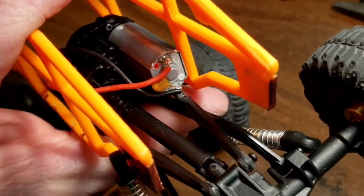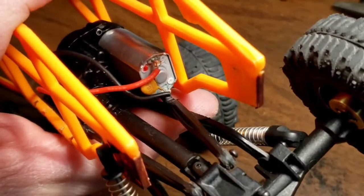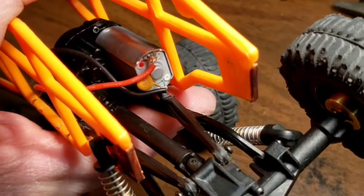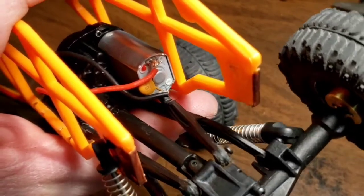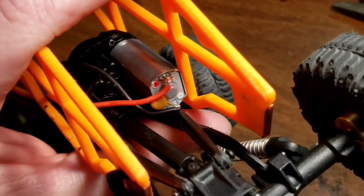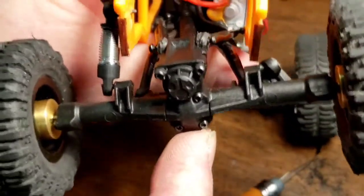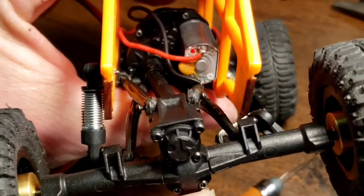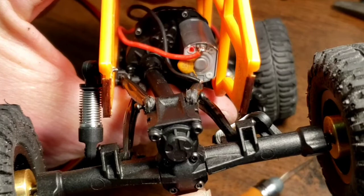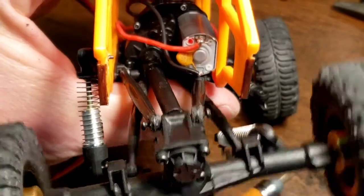And let's see, it's probably worth about 5-6 millimeters by chopping off two at the beginning. So it's worth quite a bit. And what I've done here is I've actually made the suspension so it can flex up higher than the shock is going to let it. I like that because the shock is the limiting factor, not the suspension itself.